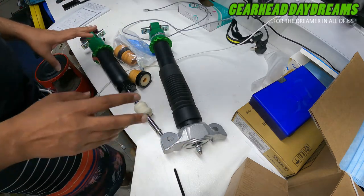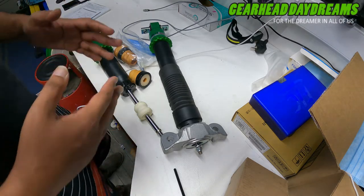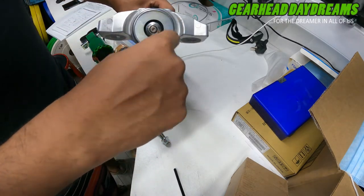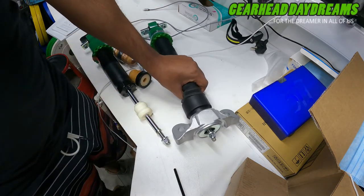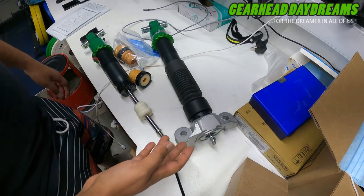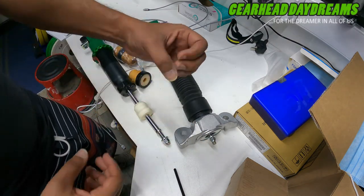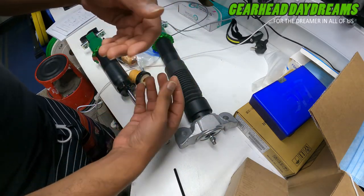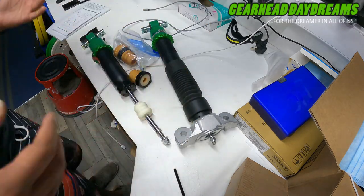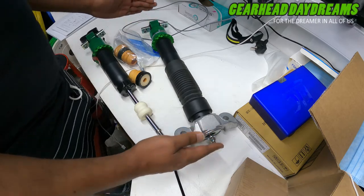Then this shock will be ready to install without the EDFC kit. I'll do another video on the EDFC stuff because that's a little more complex. I'm not sure about mounting the motor on the rear - my worry is that it will just spin. But thinking about it, the rear wheel doesn't have steering, so the shock maybe just goes up and down - that's why they haven't needed the strut kit. Whereas for the front, because you have steering, the shaft inside the shock will spin and that causes the motor to wrap the cable around itself.